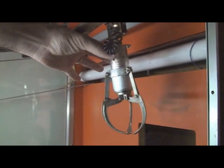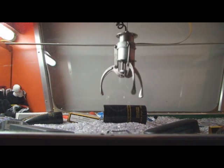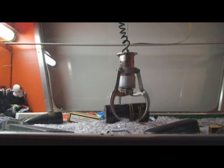An interesting thing about this particular machine is that unlike cranes I mentioned in the previous video, this one offers absolutely no way of controlling the claw's strength, even with a rheostat. The reason is that closing of the claw is controlled by gravity as opposed to electricity — it's a pretty low-tech system, but it actually works. When the claw is ready to drop, power is sent to the coil to open the claw, but when it reaches the bottom, the power is cut and the claw closes under its own weight. It carries the prize back to the prize chute with absolutely no power supplied, meaning operators have no control over how strong the claw is. The only way they can determine how many prizes are won is by placement of the prizes in relation to each other, as well as the level of gravel in the machine — because the claw can only go down so far, and you absolutely have to have all three arms of the claw reach under the prize in order to pick it up.